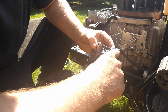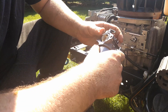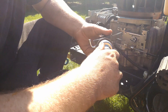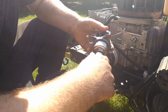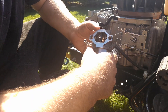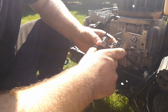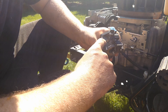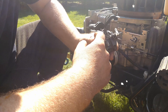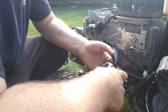This was basically a learning experience about trying to figure out how a carburetor works, and I'm still not entirely sure I understand it, but I think I'm starting to understand what the passages do more and more. Turns out these new fancy carbs don't use screws to adjust a lot of the stuff. Some of the things I've discovered: the fuel shutoff, the main jet that runs through the center, the emulsion tube that allows the gas and air to mix together and come up through the main orifice to prevent big blobs of fuel. This is your pilot jet. I believe this is air or vacuum that runs through here and into the carburetor bowl. This is a lawn tractor — it runs wide open all the time.